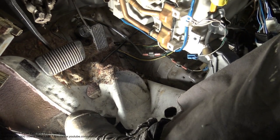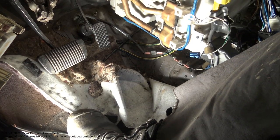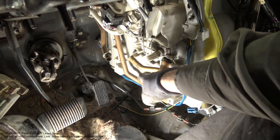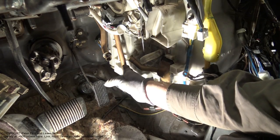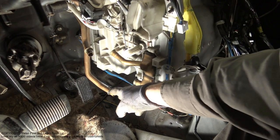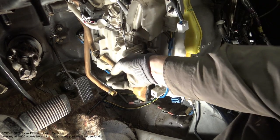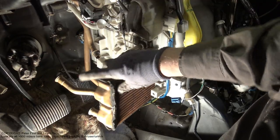I have a situation here where there is now a little bit of coolant liquid in this mattress area, and remember, this is a warning sign that there is coolant and water inside these pipes. Then I take that lower part, okay, and now we can see that there is water draining out. Now that both joints are free, I can carefully take this heater core unit, and look, there is coolant inside.